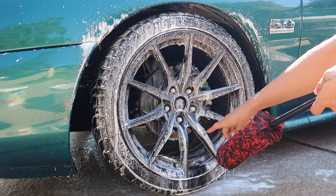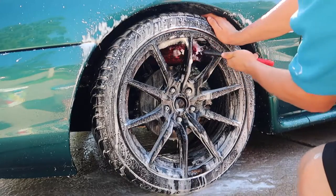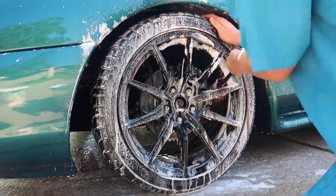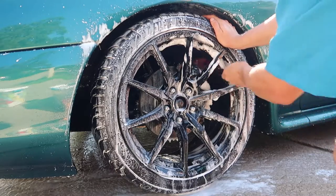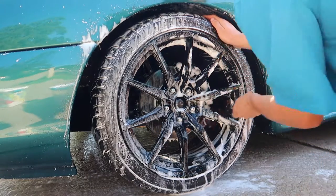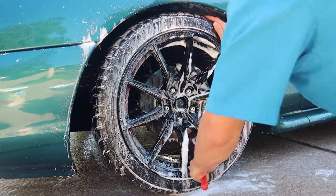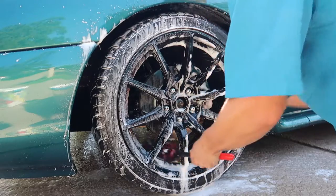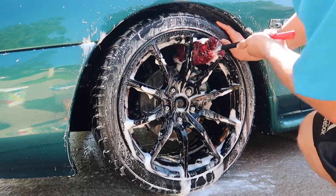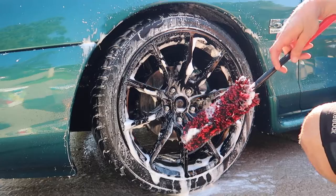Give it a quick rinse. I always clean the barrels of the wheels before the faces, starting at the topmost part of the wheel because this is where all the soap is going to fall off first. I'm angling the wheel woolly in here to get it behind the spoke and making sure visually that I'm doing a thorough job. While I'm here I'm also going to clean the top part of the caliper — I have these calipers painted so keeping brake dust from embedding on them will help them look decent as long as possible. The reason I always do the barrel first is because it's typically the dirtiest part — if you clean the face first and then get dirt all over it from the barrel, you have to do it again.